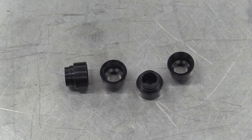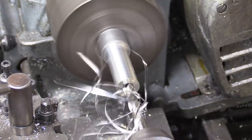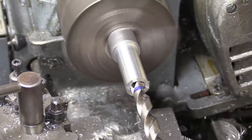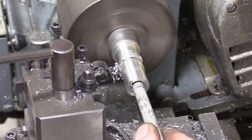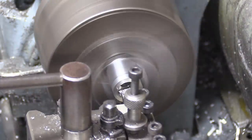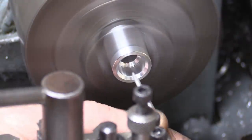First thing we need to do to get these ID1050Xs to fit is junk these adapters and whip up some new ones. We need to push the injectors away from the head, so some longer adapters are needed. Thankfully, we have a lathe and some bar stock, and we both love turning, so while it's very frustrating to have our bolt-on stuff not bolt-on at all, it's not the end of the world to spend some time with the Myford.